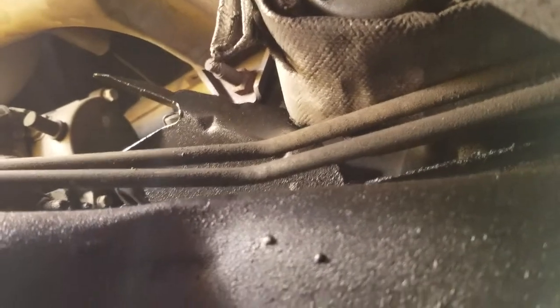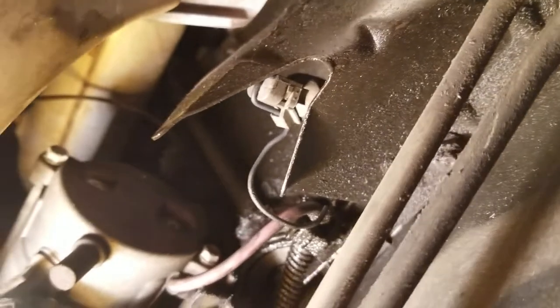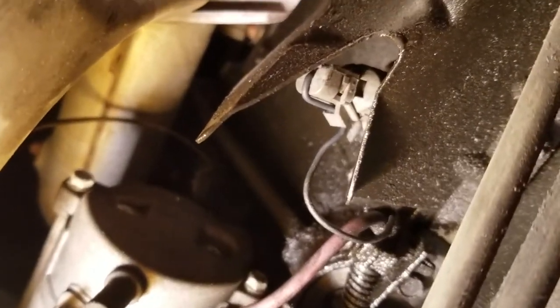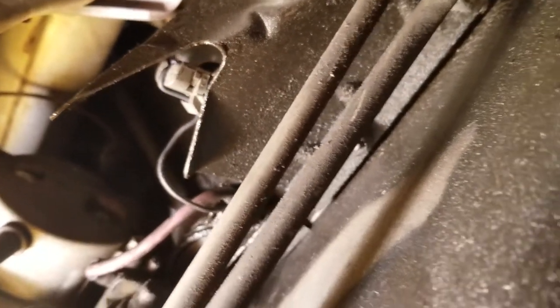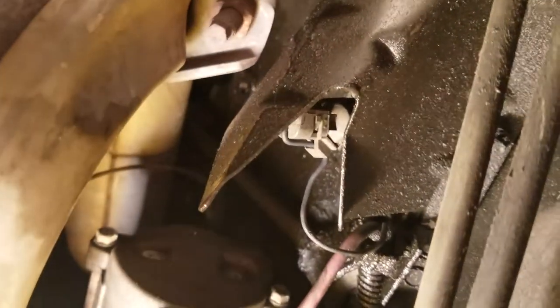After climbing underneath the car I can see I've got some oil residue back underneath here. Looking around, this car definitely has two knock sensors — there's one right there and one right here with a little heat shield, and one on the other side in the exact same spot. Everything up above them is pretty dry, so it looks like we're getting some leakage coming out of the sensors, and possibly a little bit higher — I'm not exactly sure yet. But it's almost certain this sensor here has been leaking, and that's probably why they're intermittent.